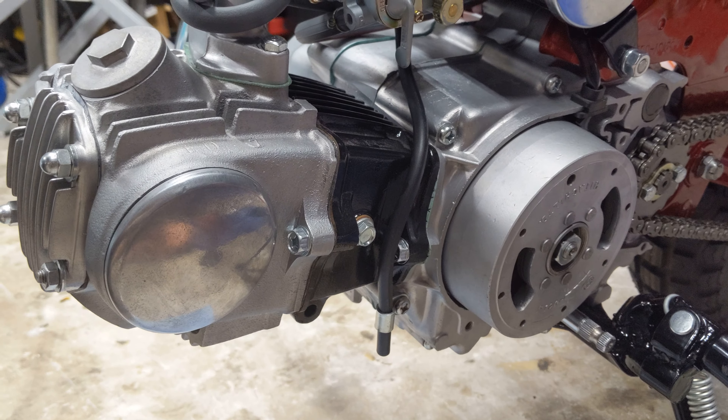All right, so now we finally see we're getting sufficient oil pressure — and that's just an engine sitting overnight. Imagine if you've let your bike sit for a whole season. Obviously there was some residual oil sitting on the cam journals and other components from overnight, but imagine if that engine had been sitting for months or over a whole winter season how dry that top end would have been — and it took that long to make sure oil was getting to the top end.